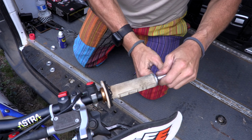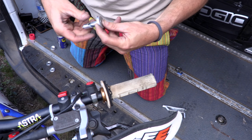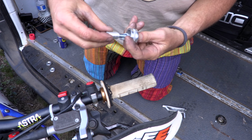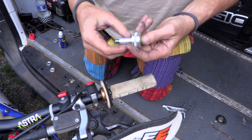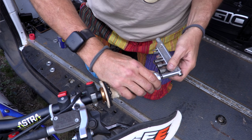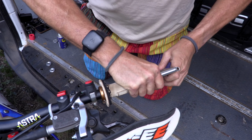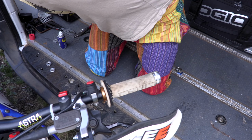This is where I have to interject to fill y'all in on my avoidable mistake that I am making here. G-Rip isn't a traditional bar end. It's more of a bar cap. I noticed this while putting it on, but honestly completely spaced. These are supposed to be installed by moving all of your controls in a quarter or a half of an inch so the G-Rip wraps over the end of the bar. I could have avoided my installation mistake and a lot of headache later on if I had taken the time to watch their installation video. I didn't, and you'll see later on how this comes back to bite me in the butt.